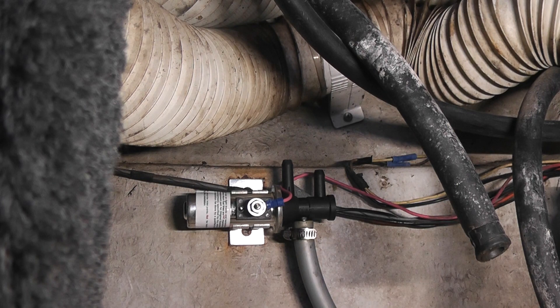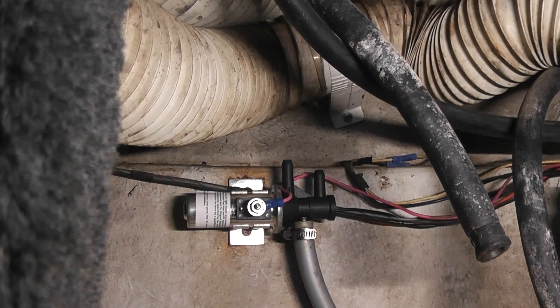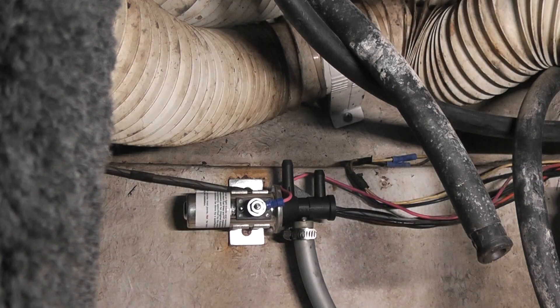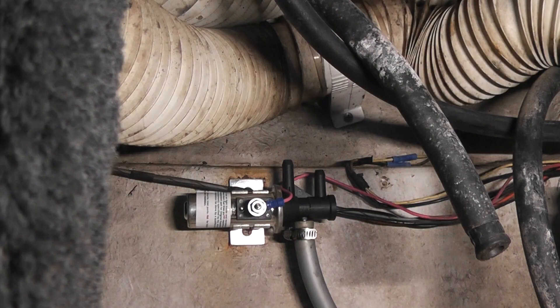This has been one of the most difficult jobs I've done on a boat — not the worst, but one of the difficult ones. Total learning experience — I had no clue how to do any of this. The one thing I suggest you do is hook a hose to it and blow through it so you see where it goes when you turn the valve on — this opens up this port.